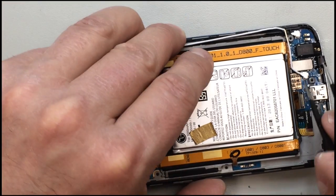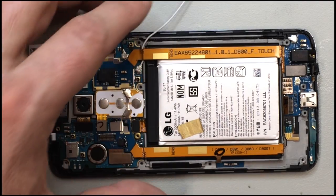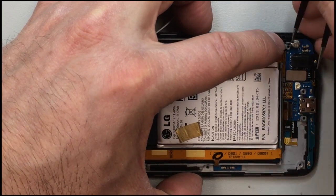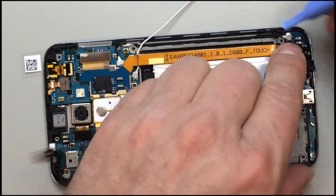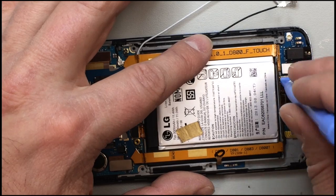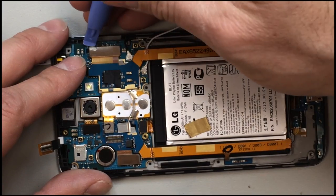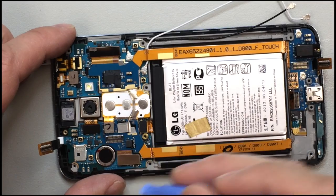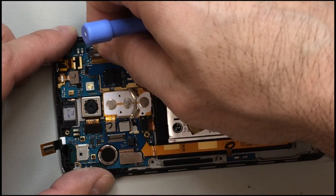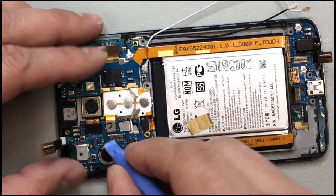You can see the antenna wire looks like it's had some pressure on it — it was like that when I opened it up. The second antenna wire down at the bottom kind of reminds me of a knockoff Samsung Galaxy phone I was working on recently as far as the design goes. Overall pretty solid but looks kind of funny on the inside. Up at the top we've got more connectors to pull off, and there will be a little bit of adhesive behind where they're plugged in towards the center — you may have to apply a little heat. Since I've taken it apart before, they're pretty easy to pop out. Just make sure you get under the edge of the board.